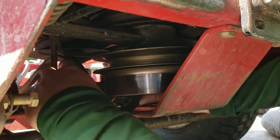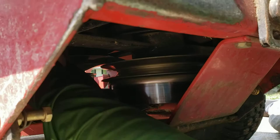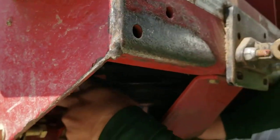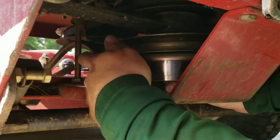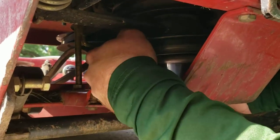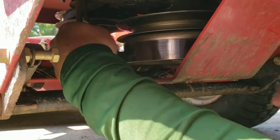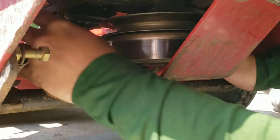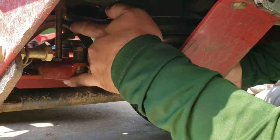The reason you got to do that is because you have to take the belt and push it free right here. And if the pulley was still there, it would be held against this pulley stop — it would be going nowhere. This guard gets in your way. On my 48 I removed it. It's supposed to protect it from stuff, but it's in your way when you're trying to do work. You just got to force it up and through.